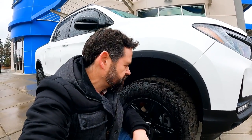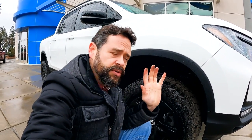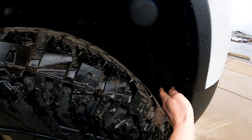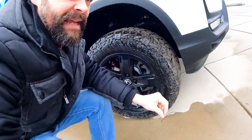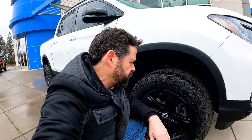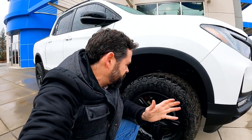The manager — the used car manager's vehicle — is actually a 2022 Honda Ridgeline. He's added 30 and a half inch tires on the front. Now you can get 31 and a half inch tires on this, but if you do that you've got to cut out part of the front fender because it'll rub there and a little bit in the back. He's also put on inch and a half spacers, and with 30 and a half inch tires it's clearing just fine.